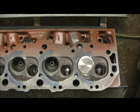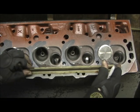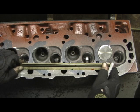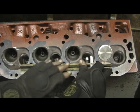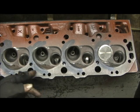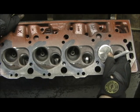When you're doing so many chambers you have to have a method to get them all lined up. What I do is simple: I find a reference point, lay my ruler on there, take a Sharpie — you can see the lines I've already marked. It just so happened that the area I needed to mark is almost half the distance of the bolt hole moon. When I line them up, I've got almost half a hole — they're pretty level. Then mark, boom boom boom — this makes me a point to grind to.